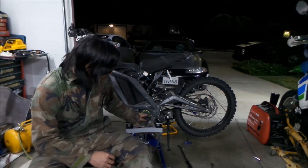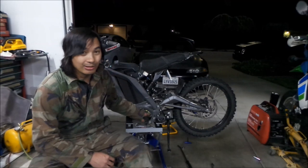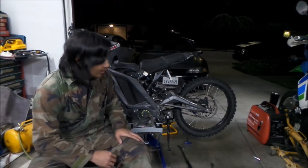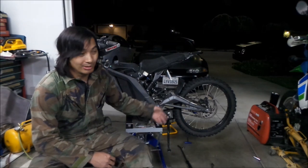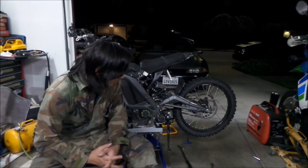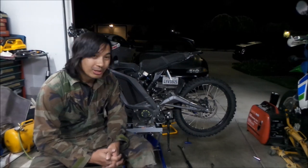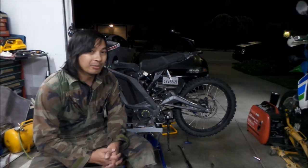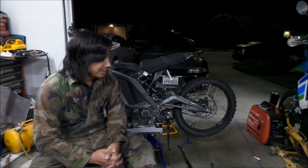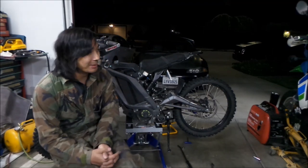The best place to view the belt is from behind this cover, and it's really not that hard to take out. It's only 2 bolts, so make sure you go in there and check, and make sure there's no foreign objects in there like rocks and stuff. You don't want that kind of stuff. If you do your proper belt maintenance and tighten it properly, I think your belt will have a long life, because it's a really good belt. I'm not gonna lie, it's just Hayes Mega just didn't tighten the belt when he had to.